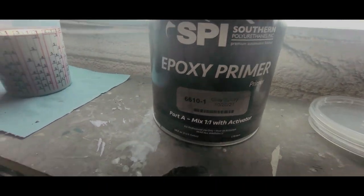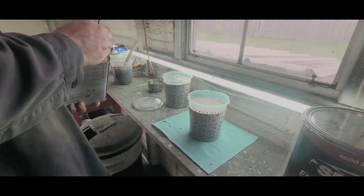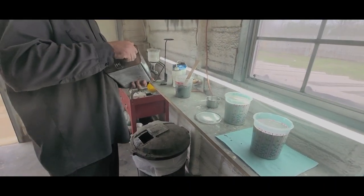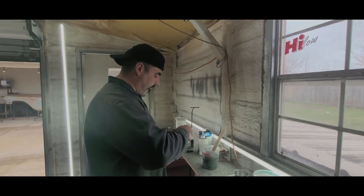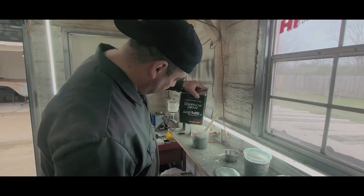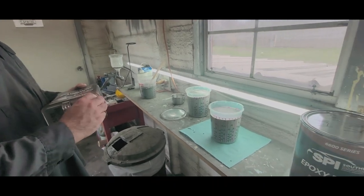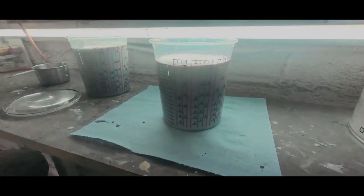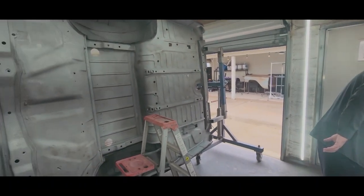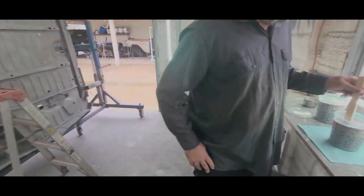So we're trying to use up whatever old we have. That's gonna dry a little faster. So it mixes 1-to-1. I find the easiest way to mix this stuff, if you're mixing 1-to-1, is by ounces. I mean, it's pretty simple math. So this cup is a quart, so 16 ounces of primer, 16 ounces of activator, makes 32. If you go a little above the 16, then go a little bit above the 32, it's not that crucial at this stage. You really don't want to overthink it,